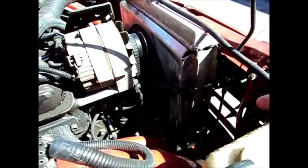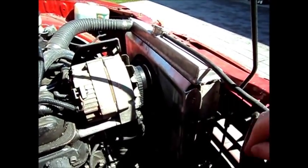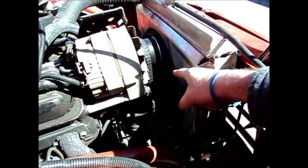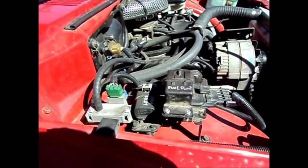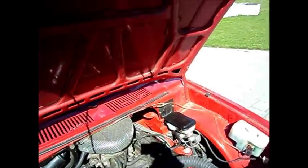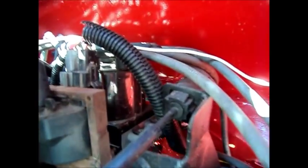To keep it under budget, the radiator's from a scrap heap, but it had plastic tanks on it and the plastic tanks split. So I fabricated my own upper and lower tanks, my own fan shroud, my own fan bracket — I don't remember what the fan's out of — and welded it all together, and it runs absolutely slick. Electronics are all here, easy to get to if you have to maintain it. Except the ignition system, which is way back in here — tell me that's fun to get to.